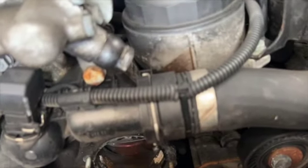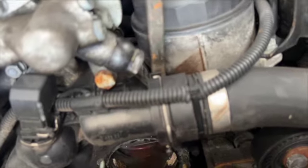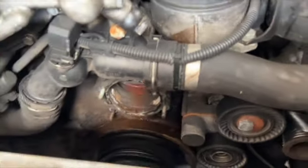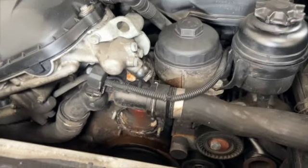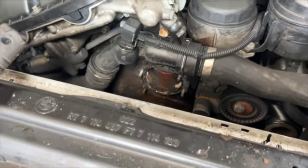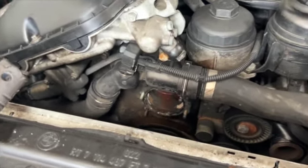The water pump is now off. It took a couple of little love taps and I had to put a lever through here to get to that nut just to break the seal, because obviously it's been siliconed in. I've called the customer to let him know it definitely was the water pump and I'm waiting for another part to arrive. He asked what the thermostat is like — I said I have no clue — and he said, as we're draining the system and changing all the coolant anyway, replace the thermostat.